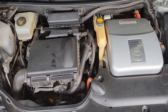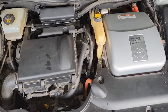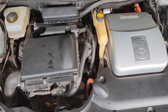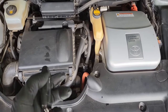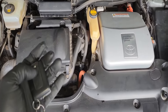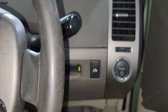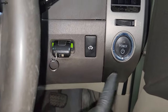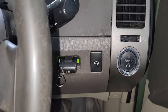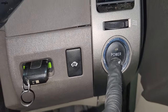This is a 2009 Toyota Prius, 20 series model. This car had a problem where, when driving on the freeway, the car suddenly stopped — no warning lights on the dash, nothing. It was only working on the 12-volt battery. When we put the key in, there's no power. I press the brake, the power button lights on, and then no lights on the dash.